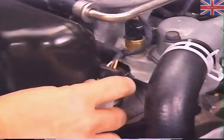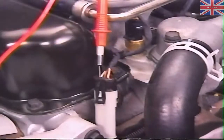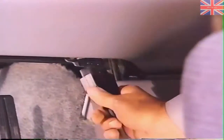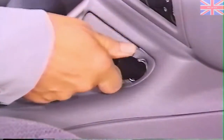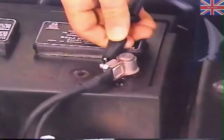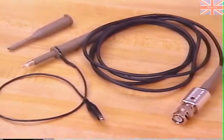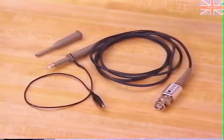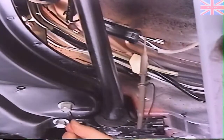When probing a sensor signal wire, be sure to use the red test lead and probe close to the sensor to minimize interference. If the DRB-3 is plugged into the Chrysler diagnostic connector, you don't need to use the ground lead. But if the DRB-3 is powered through the vehicle's cigarette lighter, use the black test lead on a good ground. For oxygen sensor signals and other sensitive circuits, a x10 cable and probe are provided in the PEP module accessory kit — these two items must be used in place of the red test leads for oxygen sensor signals, as you'll get corrupt data values if a different probe is used.